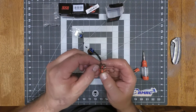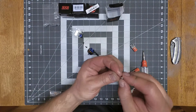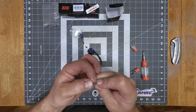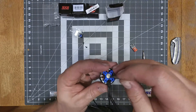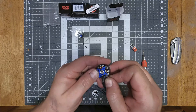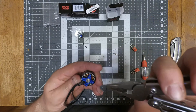What I usually do to put the clips back on is find a screwdriver bit that is a little bit bigger. You can tell there's a stamped edge where one side is a little sharper than the other — you want the sharp side facing out towards you. Then just stretch it over onto the screwdriver bit like that. Make sure your spacer is down on there, and just push it down just like that. Then grab a pair of pliers just to make sure it's seated in that groove.